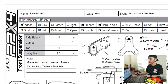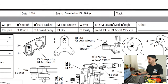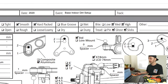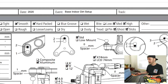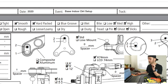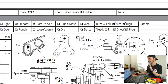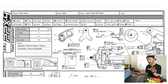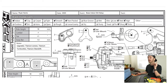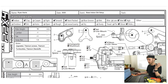We can see it was an indoor track — clay dirt, relatively smooth and hard packed. Grip level is important: bite was medium to high, so a fair amount of grip. The tread height on the tires was ghost or slicks. Once we know where this was used and the type of track, the very next thing I need to look at and identify is the tires.